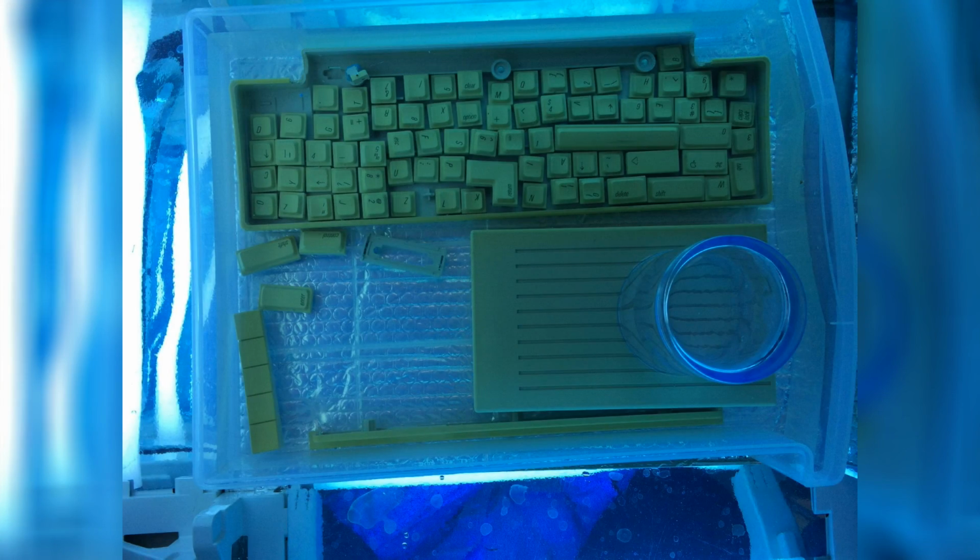He says also, secondly, I find the bubbles that form on the bottom of the submerged pieces often will cause the item to float. I noticed you used a part of a brick to weigh down the bottom keyboard cover. And he says, what I have done is use an inverted glass partially filled with hydrogen peroxide to weigh down the piece. For smaller pieces like keycaps, I use that poster putty to stick them to the bottom of the container. That way they don't flip upside down after the bubbles form on the bottom. That's absolutely brilliant. That's great ideas.